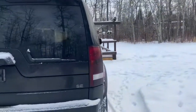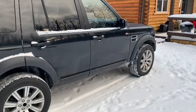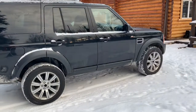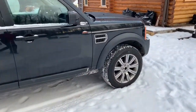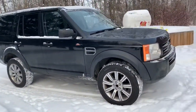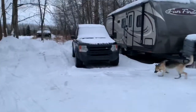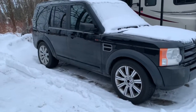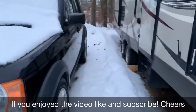It's about negative 10 degrees Celsius this morning. Left it sit overnight after the repair yesterday. It's in off-road mode right now, so it's in the highest setting. I didn't bother measuring the wheel heights to the fender liners, just eyeballing it, but it didn't lose any height overnight. The car has been sitting for 5 days now, just in normal mode, not lifted, and it looks like we fixed it. Not sitting on the bump stops.